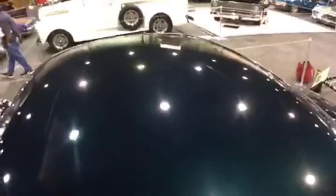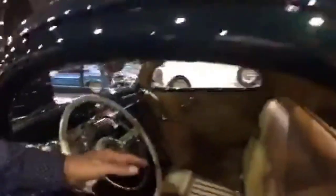Filled top — and we took some crown out of it. In the judge's book, it shows a picture that Jeff Midford-Taylor had a template made, and we brought it along to make sure it was always the same shape. Then he sent the template to the guy who shaped the metal — like a Bobby Walden type of guy — and they shaped it, brought it back in, cut it, butt welded it. Then he's doing the hammering and tack welding every two inches. I walked out of there when he told me it was going to take two days at $65 an hour. So did you do the body work? No, they did — the body work was all done there. So when you got it, it was bare steel. Bare steel — I had to prep it, prime it, and then paint it.